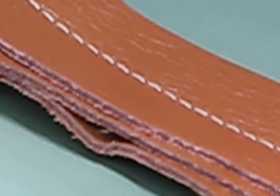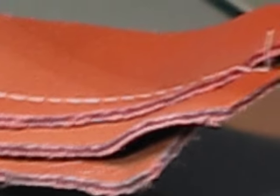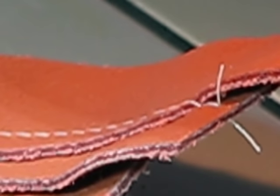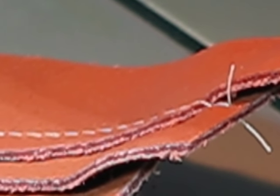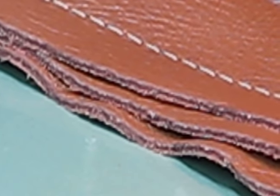And this machine came with a number of challenges. It had tension issues, as you may have seen in the Facebook posts. It had an issue with the slow gear, and we did not sew these three layers of genuine cowhide leather, 10 to 12 ounces, using that slow gear. Again, I want to dispel an urban legend, a myth. The slow gear is not going to give you an edge on sewing through this type of material, this many layers.